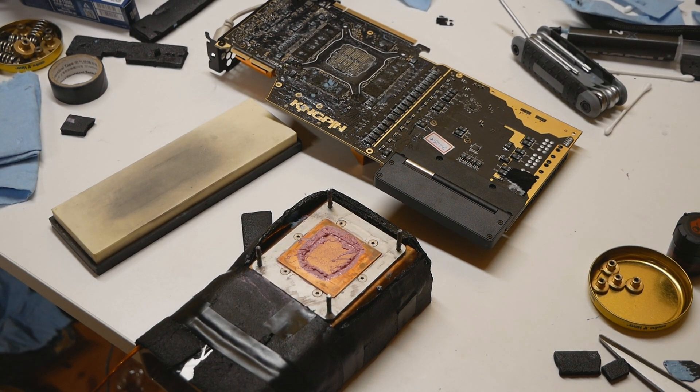Based on Biso Biso's recommendation, I mainly used 1500 grit Matador sandpaper, though you can go finer like 2000 grit. I don't think the exact grit matters that much since DeBauer used very rough grit polishing film and it worked fine. Many thermal pastes do work if the GPU finish is very good and you have a good mount — people have run full pot with pink thermal paste and KPX. It's not only about the thermal paste: I've had good runs at full pot temperature with pink paste, then changed the mount and it cracked instantly at minus 160.